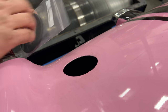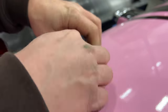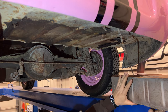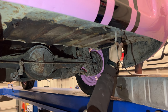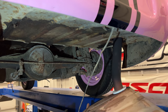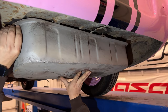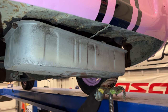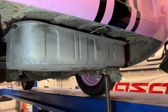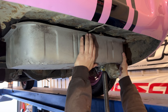Before the tank can be reinstalled, I need to put the grommet into the body. I'll get my sender wire connected — don't forget to do that first, otherwise you're going to be taking the tank down again. There's a piece of the old tank body grommet that goes up on the top. I'll put one nut right here to hold it, and set my jack under this corner so I can lift the tank up when it's in place. With my hand on the filler tube positioning it, I'll lift it up with the jack. Now I just need to get the bolts lined up.